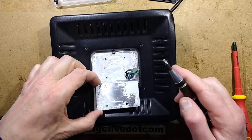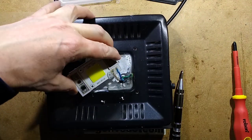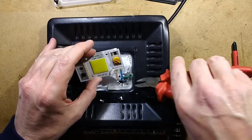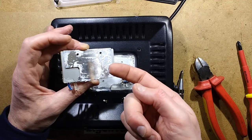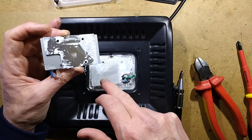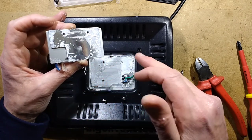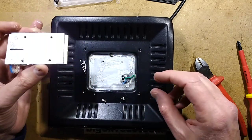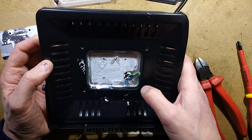That's not inspiring. The cable is literally — let's chop that off. Heat sink compound — look how dry it is under there. Actually it's got clear silicone liquid, but the heatsink compound has not made contact over there at all. That could also be part of the reason for that hot spot. The cables are literally just rammed into the case and then pressed flat by the heatsink.